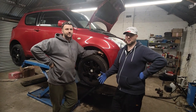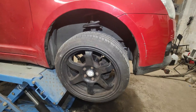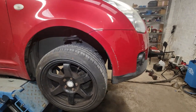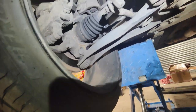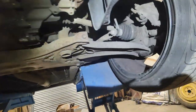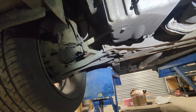I went with Mark to buy the car, had a look around it, but since then Paul's checked it and there's quite a few things I missed as usual. So here's a quick list from my five-minute check. Number one: the inside of the discs is pretty bad, they're going to need replaced. The drop link is completely the opposite of the other side — it's at a 45-degree angle, so it's been fitted wrong and it needs swapped round.